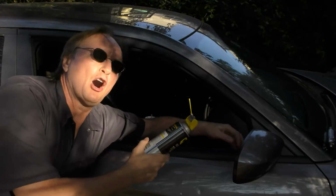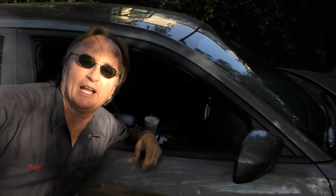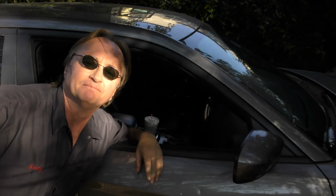Now you want to do all 4 power windows. You only need to do them maybe once every year or year and a half to keep the crud from building up and making them bind. And really, that's a small price to pay. If you let one of these window motor regulator assemblies go bad, they can cost $300-400 for new ones.